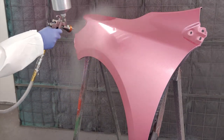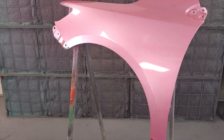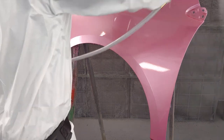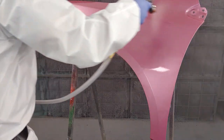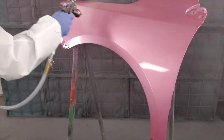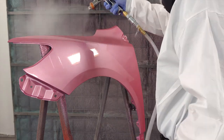Once you have a good spray pattern, it's a good idea to spray a test panel to make sure the product flows well and you're happy with your settings. Apply three wet coats with 50 to 75% overlap, allowing 15 minutes flash times between coats. A 6 to 8 inch fan pattern at approximately a 6 inch gun distance is a good general rule. After your last coat, clean your gun immediately with a gun cleaning solvent, lacquer thinner, acetone, or MEK. Check local regulations for compliant gun cleaner options.